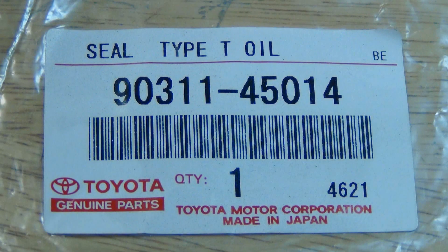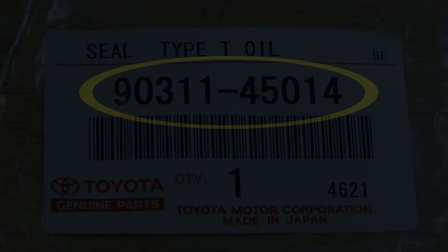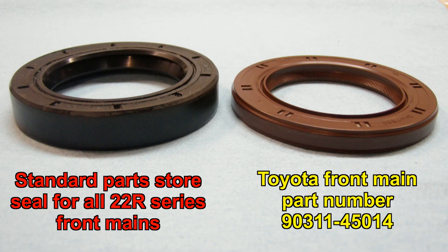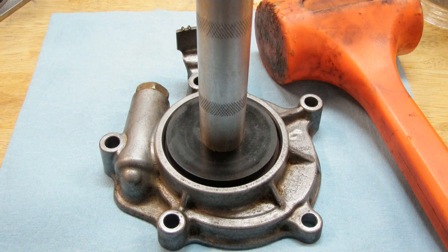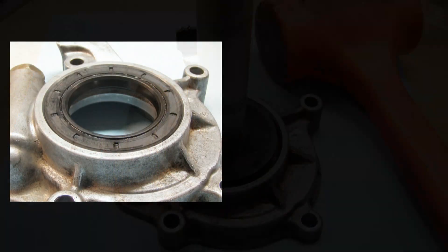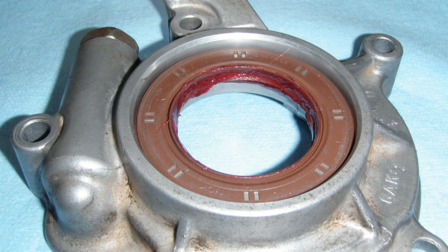However, if you go to Toyota and order the Type-T oil seal, part number 90311-45014, you'll get a much thinner 7mm seal that can be driven into the oil pump, effectively locating the seal lips on a different, unworn spot on the crankshaft pulley sealing surface. Some people have said that you need to drive the thin seal in just past the surface of the oil pump, but in my experience, driving it to the bottom of the bore of the oil pump works just fine. This also ensures that the seal is square in the bore, because if it isn't in there perfectly square it's just going to leak again.